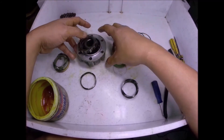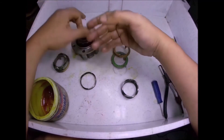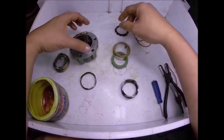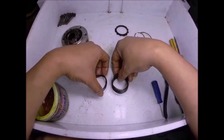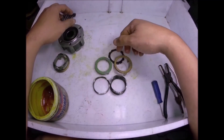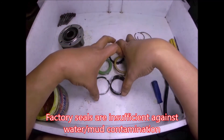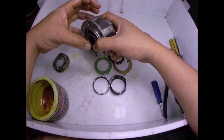The main components to force lock and force activate the four wheel drive, you can still use them. You don't need to buy a brand new unit if you don't have enough money and it's not too inconvenient for you to just remove the six bolts every time you activate the four wheel drive. These are the easily worn parts — these are usually the parts that fail because of deterioration, always because of contamination from water and dirt, which leads to the failure of these components and will eventually cause the failure of this autolocking hub.